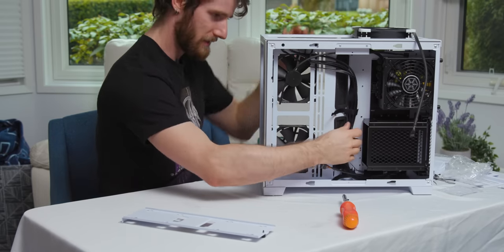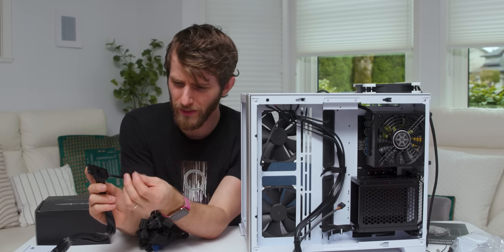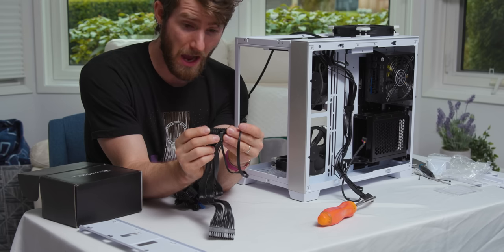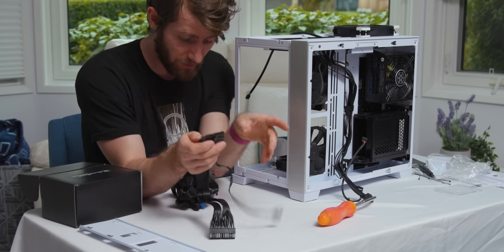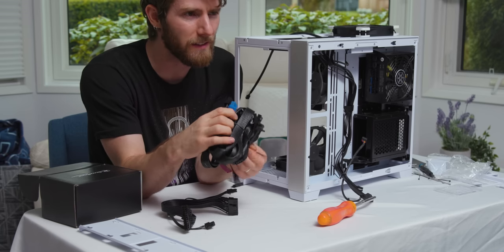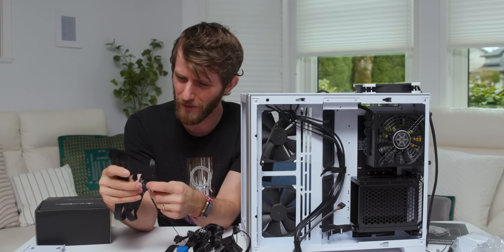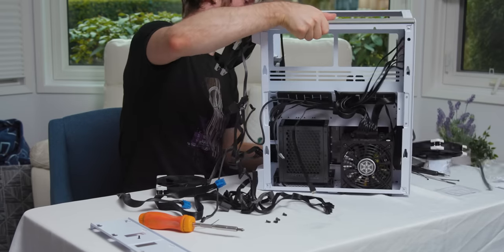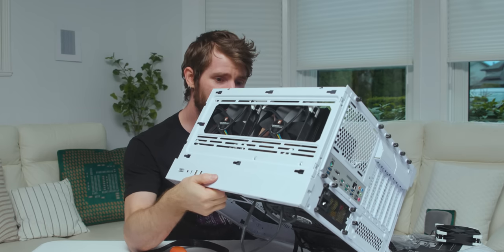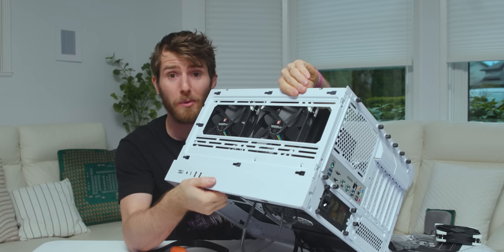It seems like the 24-pin on this Silverstone power supply has a secondary 4-pin coming off it, possibly for the secondary CPU power connector — I'll just try it. There's a separate 8-pin that'll provide most of the power for the CPU anyway, so I'm not worried it'll break anything, it's just a really weird thing to do. The build gets a bit disorganized here — the fan cables can't bend a certain way and still allow a 140mm fan in, but we did get it in.